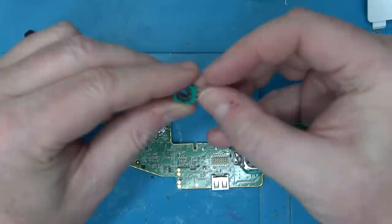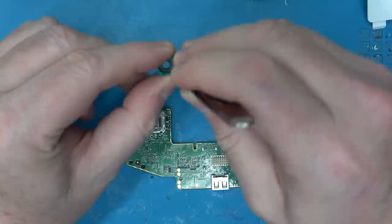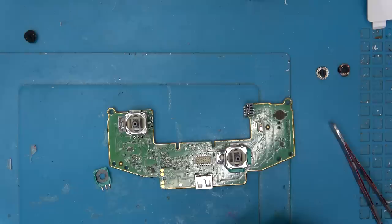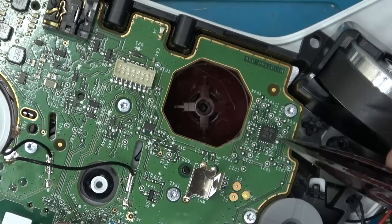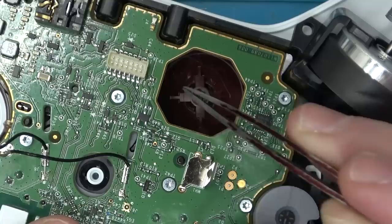I think part of it is that a carbon film potentiometer is meant for adjusting equipment — it's not really meant to be moved that many times. It has a shelf life, like everything does. Something's causing the carbon to be worn away at a higher rate than it used to be. Since 2016, they actually added an I2C IO expander — instead of mapping all buttons one-to-one over the connector, they send it as a serial signal. It's cheaper to put in a chip than another connector. The D-pad is so much clickier than the old versions — they just made the mold hollow so it echoes more.